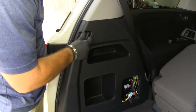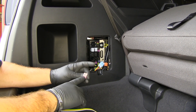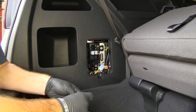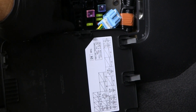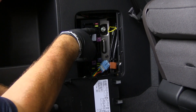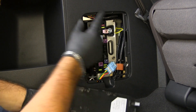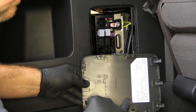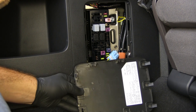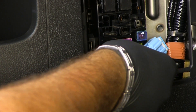Reinstall our holders here. We'll install our cartridge fuse — 30 amp — and we're going to put that in spot number 12. If you look on the back of the panel and turn it like this so it matches how this is set up, this is going to be spot number 12 right here. We'll insert our 30-amp fuse. Then you're going to have two micro fuses, which are going to go into slots 10 and 11, which are these bottom two right here. Then we can replace our panel.